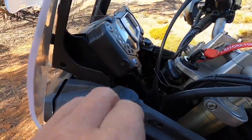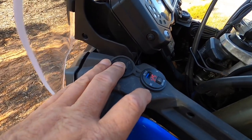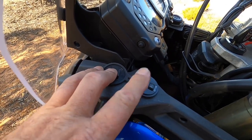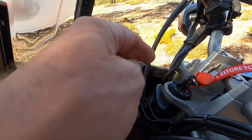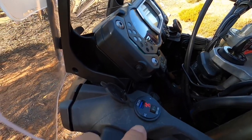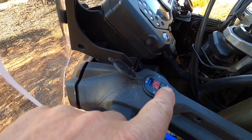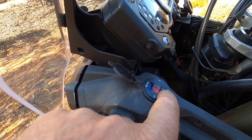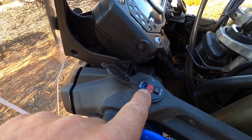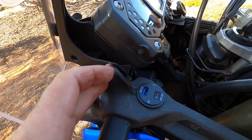Because it's a 10-year-old bike, I've added a USB outlet — hardwired so your ignition doesn't have to be on — and there's also a standard 12-volt outlet. Pretty well everything nowadays is USB anyway. It also works as a voltmeter so you can check that you are charging while riding along.